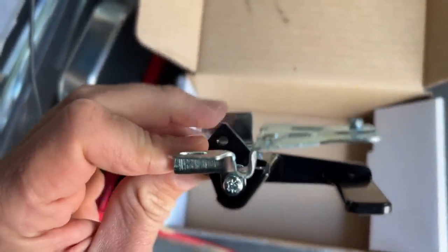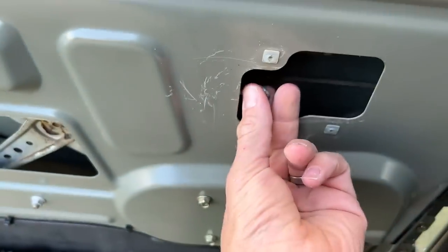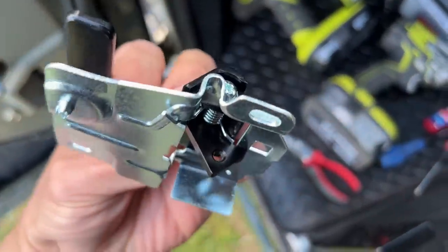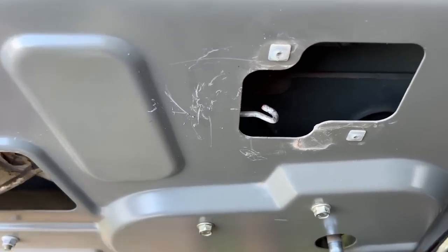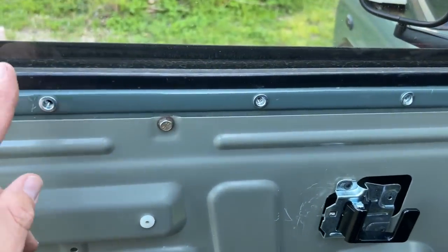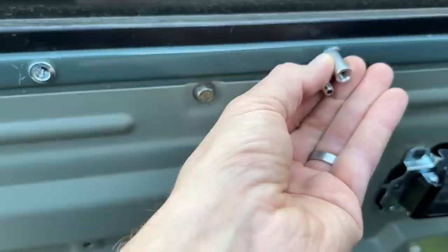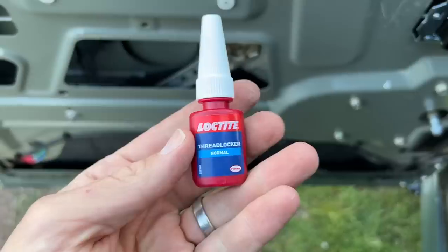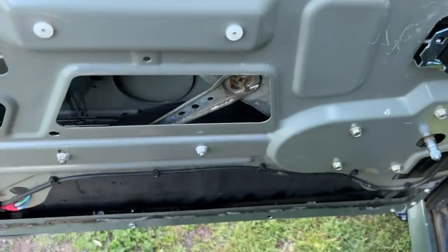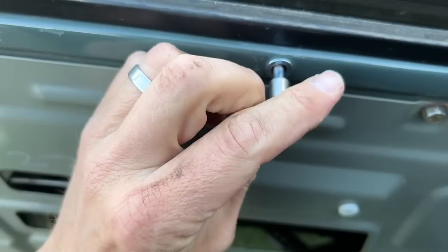I've got to work out how it connects to the control rods. This is the little hook that pulls the door mechanism when you pull the handle. It's quite difficult to get in — on the other side I actually had to bend it slightly to get it in place. For the rivnut positions, we need to put the threaded bars in so they stand out this far, which gives a bit of an armrest at the top. I highly recommend thread locker — Powerful UK recommend it too.